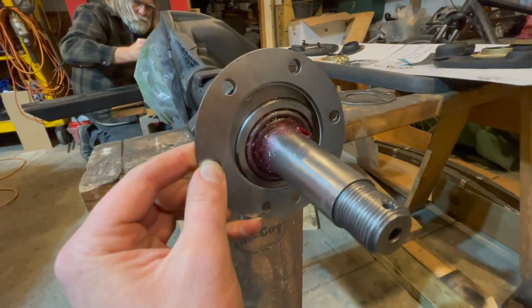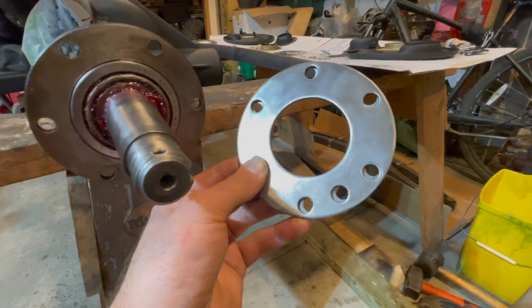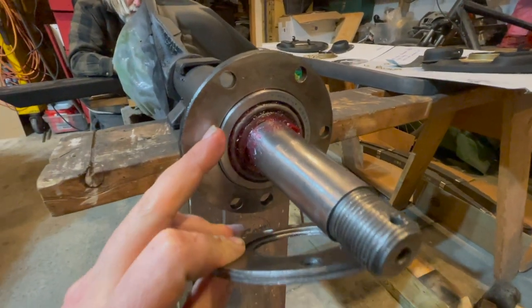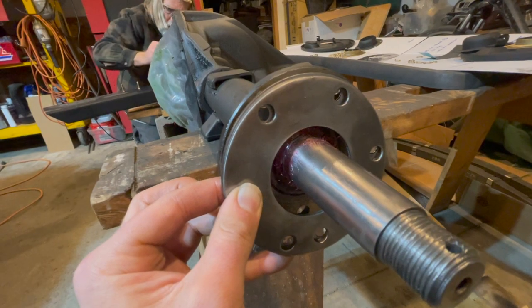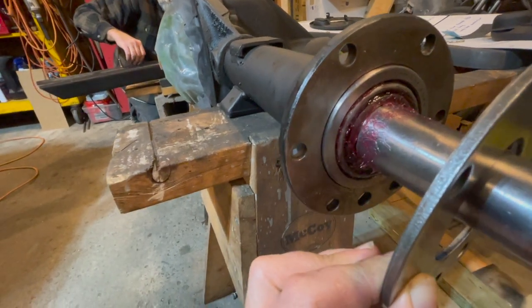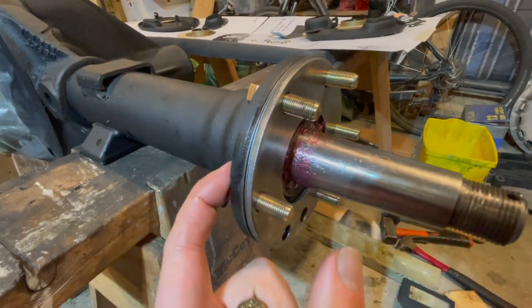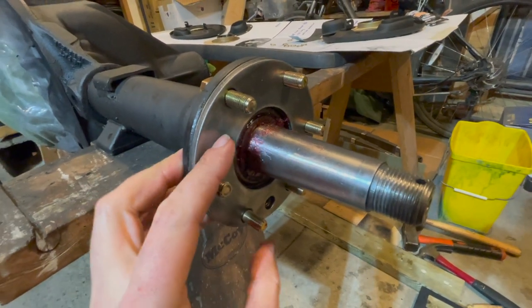Make sure everything is lined up and we'll put bolts through while installing our bearing retainer on top. With all 5 shims lined up with the holes, put your bearing retainer on top — the bearing retainer has a smaller diameter than your shims, and it will put pressure onto the cup. We're working on both sides at the same time, so it has to be shimmed and torqued together. Align all the holes on your shims and bearing retainer with the holes on the axle housing, ensuring the drain hole is aligned. Put all 6 bolts through and torque the grade 8 bolts with the nut to 30 foot-pounds so we can test the end play with the dial gauge.